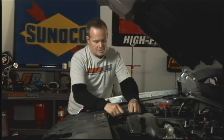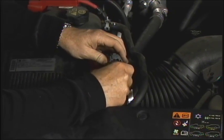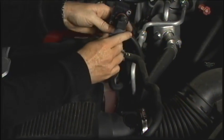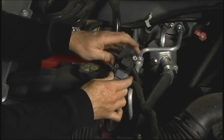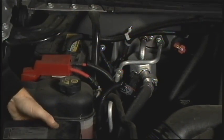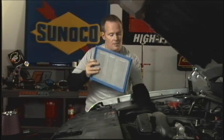We've pulled out a number of Torx fasteners here and done one for an O2 sensor and the mass airflow sensor. You've got to be very careful whenever you pull this out because those elements on the inside of the sensor are extremely delicate, both to jarring motions and anything else that might get to it. So be very careful in where you move it and where you set it away. We'll pull away the old restrictive air box and assembly, but make sure you keep all of those fasteners. Most are supplied with the new system, but keep the old ones too — you may want to put the old intake on a different vehicle with the same application and take your million mile filter to the next one.